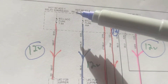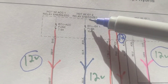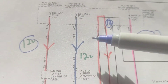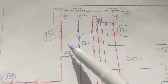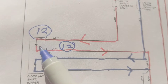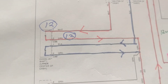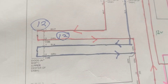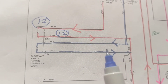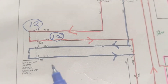There are two relays — one activating ignition, one for accessories. A relay energized makes these hot with accessories, and this one is hot with ignition. These are relays that activate current through the fuses. Now a diode is a one-way valve — current can only go in one direction, not the other. Sort of like a one-way street: traffic can go one way but you can't go the other way.